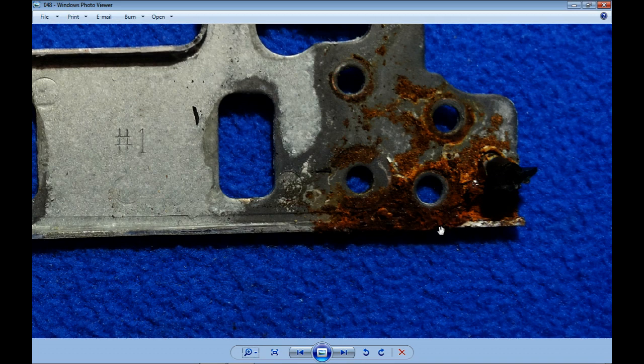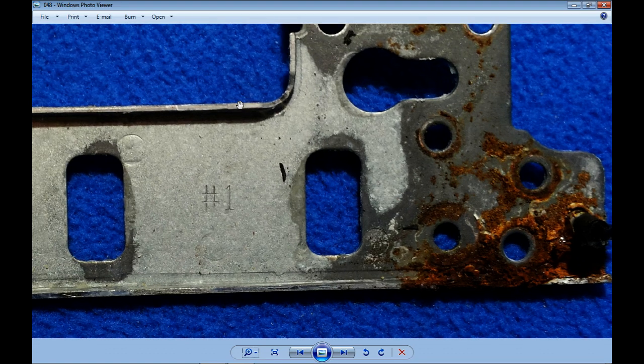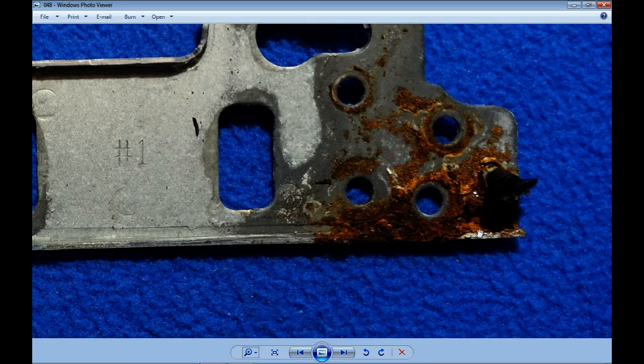Let's take a look at this little part. If the metal is this thick and the oxidation went so fast, do you think it will wait so long in your motherboard or printed circuit board? Once it is wet, it will not wait for you to bring it to your electronic technician or engineer for service. So, as I said, my first advice: remove the battery immediately, don't put it back, and bring the thing to somebody who can help you fix it professionally.